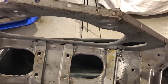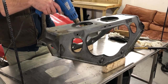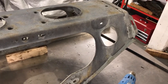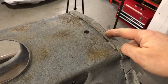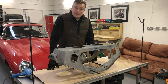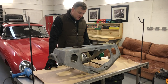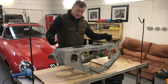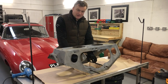I've got that gun metal kind of look to it again, which shows that the acid has been doing its etching process really well. I'll get it out of here, give it a rinse and get the heat gun to dry it out. I've now got a nicely primed and etched rear subframe — just a few areas I need to be doubly sure of, and there's still a little bit of moisture in here that needs drying out. Obviously you need to pay particular attention to the holes as well. I've set up my workbench with some paper to stop the paint getting on there because it's a real pain to get off. I'm actually going to turn the frame upside down and paint from the inside, then prop it up using these bits of bar on blocks of wood so I can get both inside and outside done at the same time.